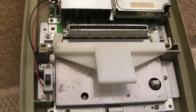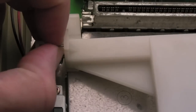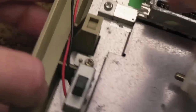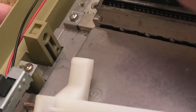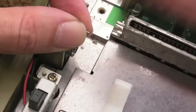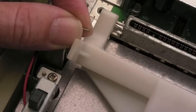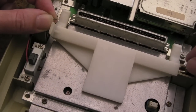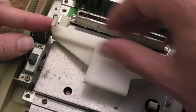If you look into this plastic piece in the case moulding, there's a hole for the main bar, and there's a little hole down there. Take your spring, put the end in there, line it up with the hole, then slide your bar through the plastic piece and into the spring and into the hole in the plastic. Then as you sit that down, it sits here like this.